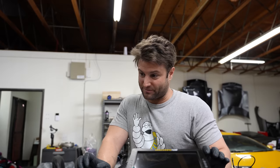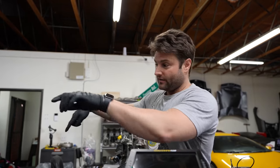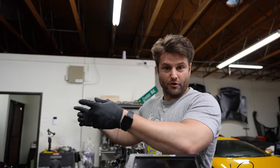As it was spinning the first time, it was arbitrarily 15 miles per hour. But this time when he was spinning it, it was only 6. So it's roughly half. That's kind of neat because that means 0 plus 15, 7.5, you know, roughly in there. So it's pretty cool to see that all working, especially when turning. I'm curious to see the speed differences even from front tire to front tire, because the inner tire is going to be traveling slower, right? I think we'll have some really cool data first and then traction control strategy from there.